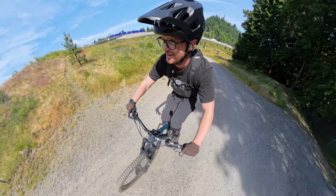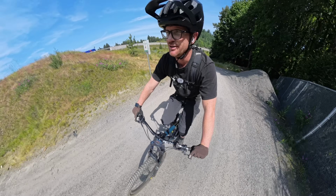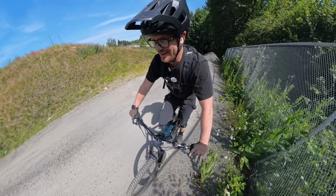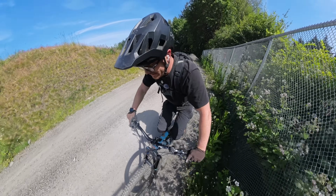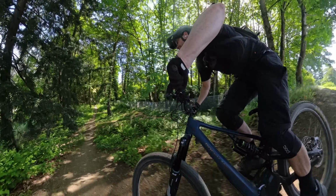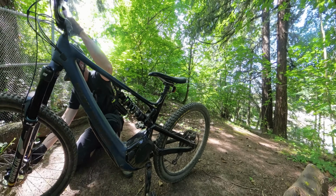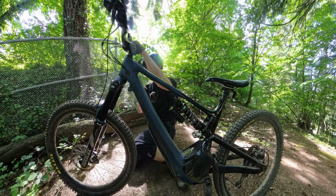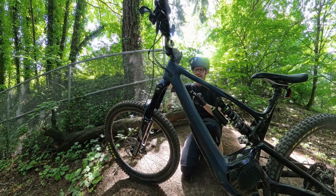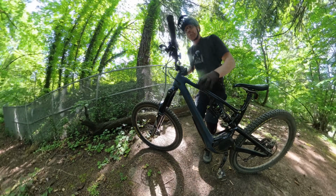So the rebound valving is pretty funky. On a positive note, the 2 tokens in there, it does have the right progression level. So I don't need to rinky dink with tokens. And why they put the sag indicator on the compression side. Okay, adjustment time. So the fork is sluggish. Once again, they have like too much valving on the rebound side. So the nature of this fork is tuned in the slower control department.